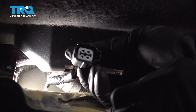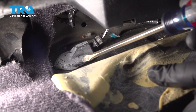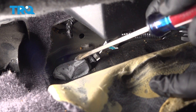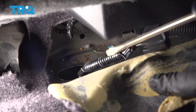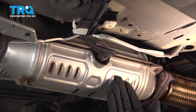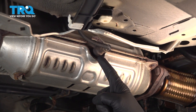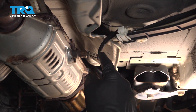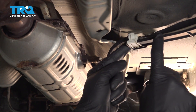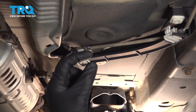Give that a quick inspection — it looks perfect. Let's follow that wiring. You'll find a rubber plug that goes down through the floorboard of your vehicle. Use a screwdriver or small pry bar and gently start pressing this down through the floorboard. Now we can make our way underneath the vehicle. We'll be looking for our catalytic converter, located just behind your flex pipe — that's where the downstream O2 sensor will go into the passenger side. Before unscrewing the O2 sensor, let's get a little slack on the cabling. You'll find a small plastic bracket; carefully remove the wiring from it.